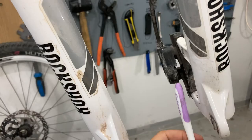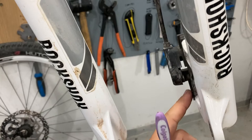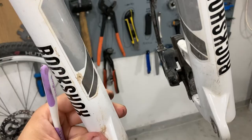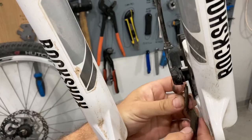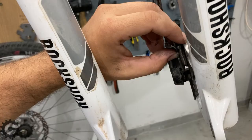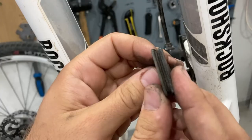The left hand side brake piston is doing almost all the work, causing some rubbing. The rubbing of the disc happens on the brake caliper, not on the brake pads but on the caliper itself, because it's moved too much to the right when it was being centered. The brake pads should be evenly spaced, but instead they were moved a bit towards the right, causing the disc to rub.